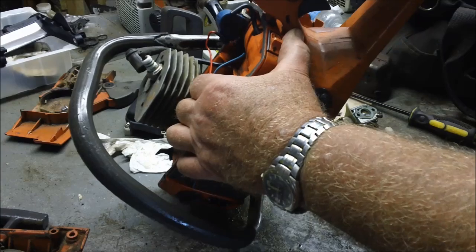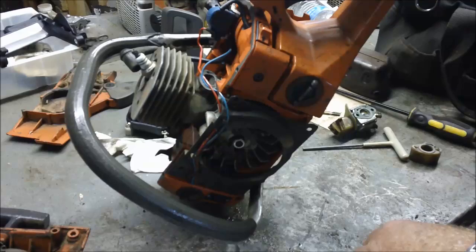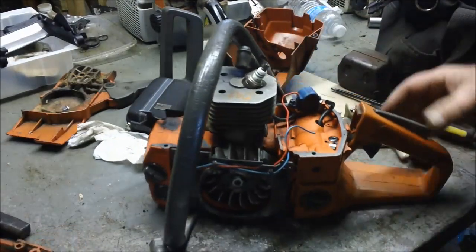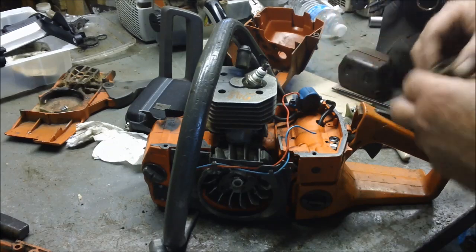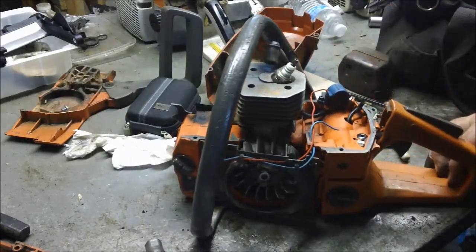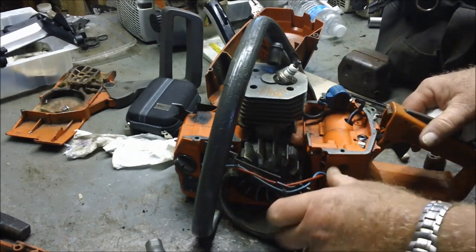From the way this is all wet right in here, it's just wet. It looks like it was drawing right through there. I believe there was supposed to be a gasket there, and I don't have one. And there's a raised section here. So I'm afraid we're going to have to rely on things like 1194 for gaskets on the intake side and just hope it sticks. Not good, but certainly better than if it's case seals, which was my original speculation. 1194 to the rescue yet again.